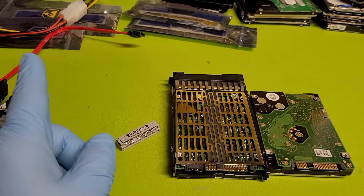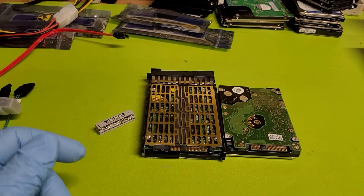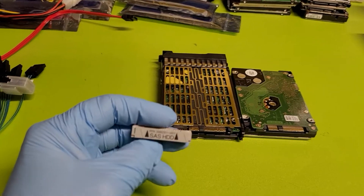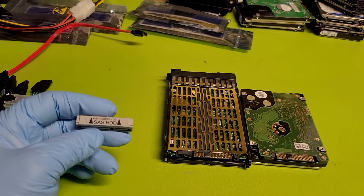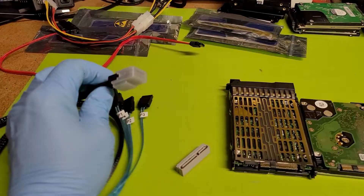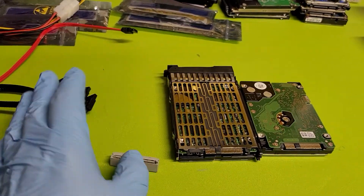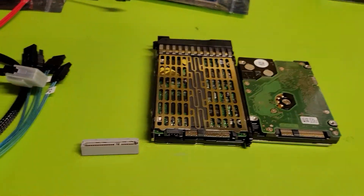All in all, I prefer this one over the other, but I have both because I deal with both old and new. This one is really good for more modern G7 and above HP server class platforms that people are trying to reuse. Get yourself a Dell or HP HBA controller for SAS — they run about $15 to $50 — and they'll give you plenty of testing capacity, four drives at a time. It's definitely easier than doing diagnostics on full storage arrays. Anyway, that's my two cents — please like the video and God bless.